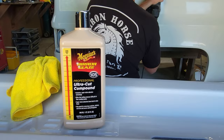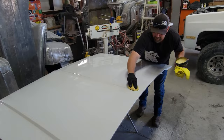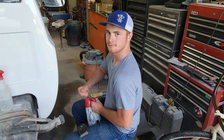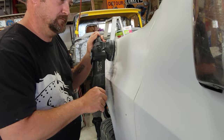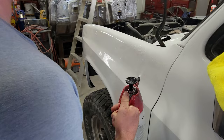Now it's time to get this Chevy square body cut and buffed, using only the highest quality Meguiar's Mirror Glaze. This stuff helps remove swirl marks, levels the paint, removes orange peel, and protects the paint. We also use Gold Class wax to make it shine. Upon inspection we did find a few runs on the truck, so we're going to go ahead and hit it with some wet sanding, then take care of it with some buffing and wax. Jason notices some runs on a panel, so we'll stop buffing, wet sand that, then rebuff, get it waxed, and make it look like it never happened.